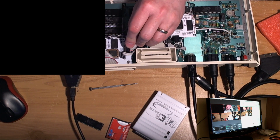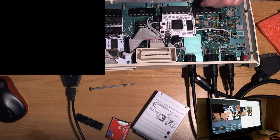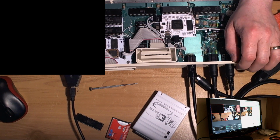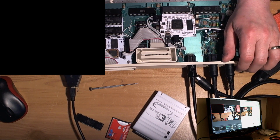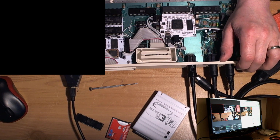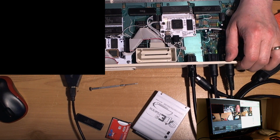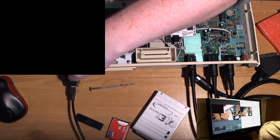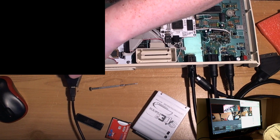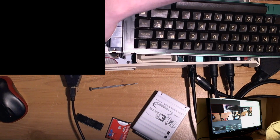But the thing with the cartridge not working on that machine, as soon as I read it, it reminded me of a problem I'd seen on another 800XL years ago. It might have been the MMU itself. I don't know what happened with that. I'd almost suspect a bad socket connection. The issue seemed to happen immediately after the motherboard was having its POKEY changed. Yeah, maybe. Yeah, let's take the board out of the case and have a bit of a feel around. And nice to know that even when this is fixed, we've still got to figure out what's wrong with that POKEY chip.